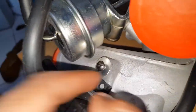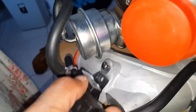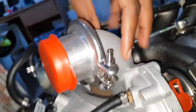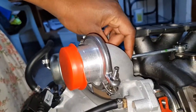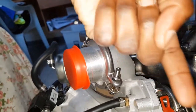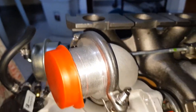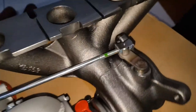Alright, so they ship this disconnected to keep this nice and loose. You don't want these nipples breaking off, so it stays nice and flexible that way. Right, so the T model that I was making reference to earlier, you have some of the T models where this entire assembly actually points downward. That you definitely don't want. If you happen to get one of the T models that this whole setup here points down that way, you definitely wouldn't want that, because it would be colliding with the subframe, which is then another interesting kind of worms that you definitely don't want to have to deal with.